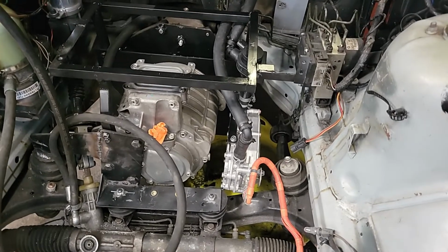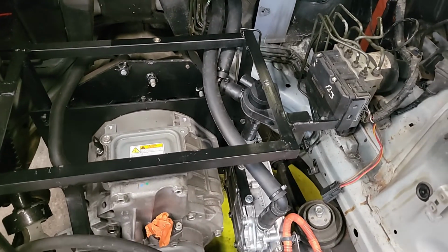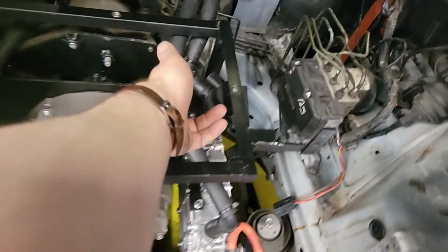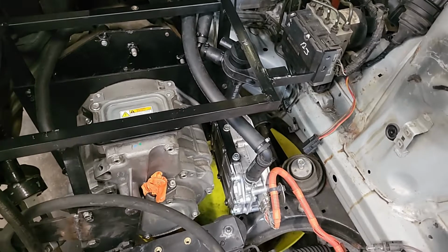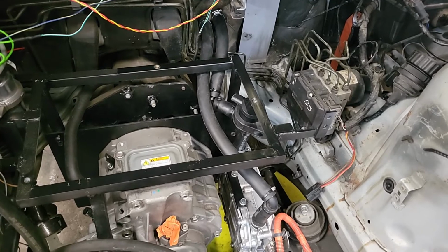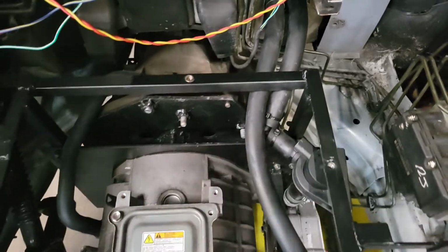Heater installed, and some maybe permanent piping. So we've obviously still got to add a header tank. We've got to have some way to fill this all up. And I'm not totally happy about having a 90 degrees in just after the pump. And these pumps I know are meant to be horizontal. You're meant to have the inlet horizontal ideally, but I found they work absolutely fine in that orientation. And it's not like it's ever going to be short of water, given that this thing's always going to be full because it's down low and the header tank's going to be up high. So it shouldn't run dry at any point. It's not like it's having to lift, pull in a huge head from below. So I think that should be okay, and it should get around that 90 okay. I don't think that'll cause too much obstruction.